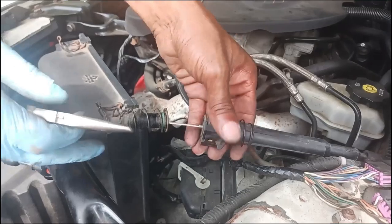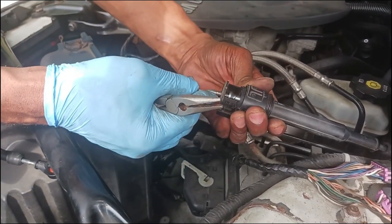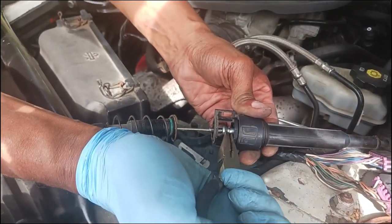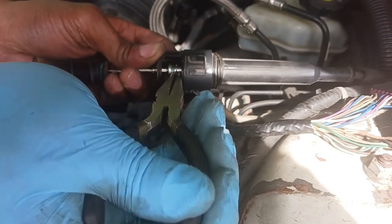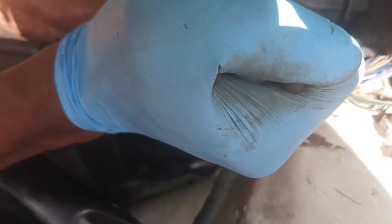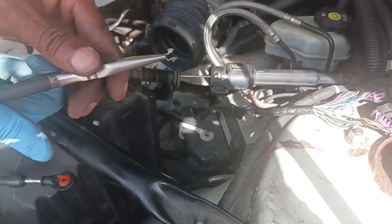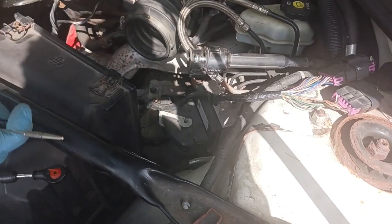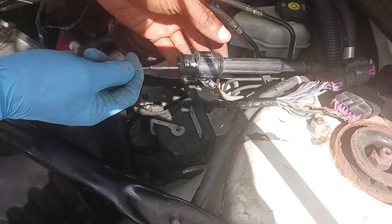There's a little pin in here — a C-clip — that has to be removed to separate these cables. It's down in here and I'm going to grab it with my needle nose. It might be a good idea to spread a shop towel under where you're working just in case this little clip falls, because it is pretty tiny and if you drop it you might not be able to find it again. It doesn't come with a new one in the package, so you have to reuse the one on the car. Once you get it out, that's what it looks like — you're going to have to reuse this when you install the new cable, so be careful with that.